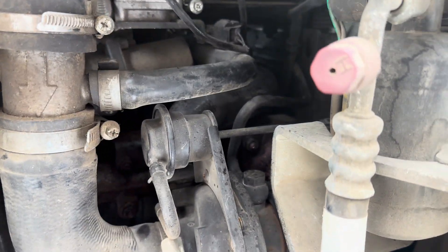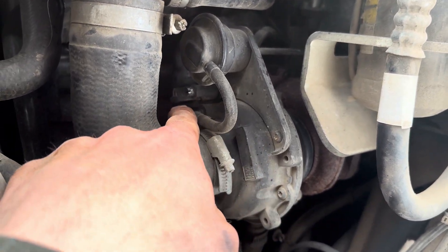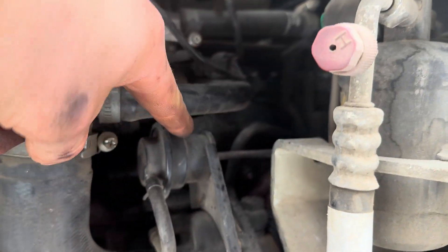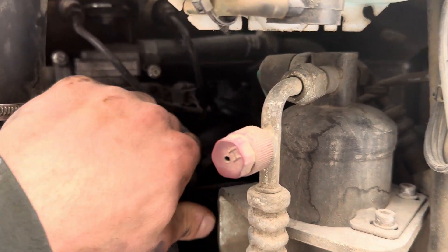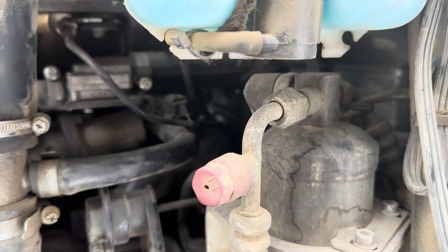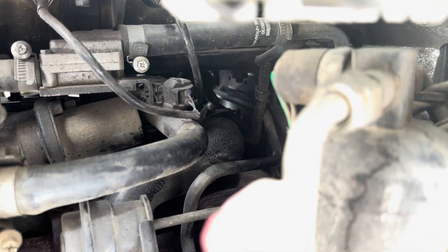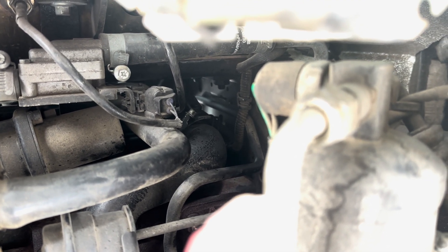I had no torque. So you want to check this hose. It's kind of hard to see, but here's the turbo. There's a hose right here — that's the start of it. It's about an inch and a half around, and then it goes up and over and into the intake. It was right off — it wasn't even attached back there. There's the hose clamp for it right there, and that's actually the hose itself. It had blown right off, and the hose clamp was just sitting there.